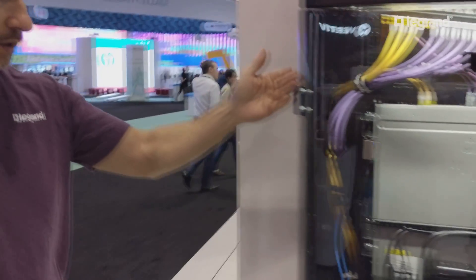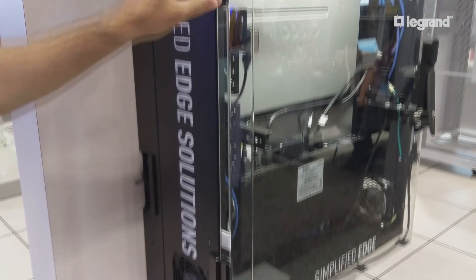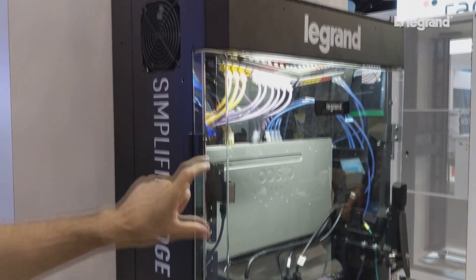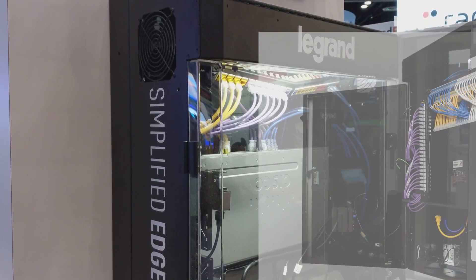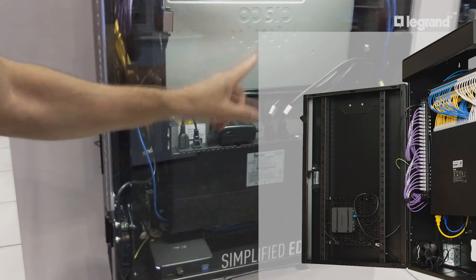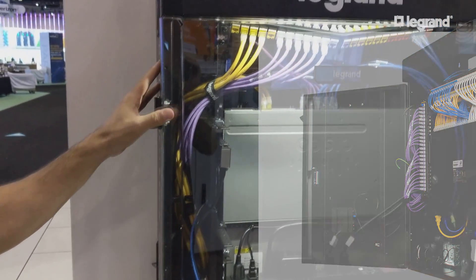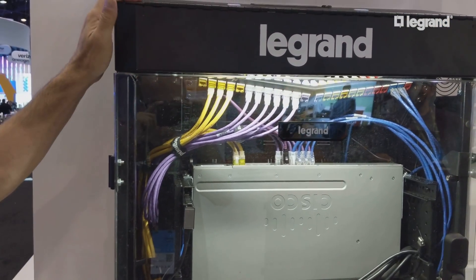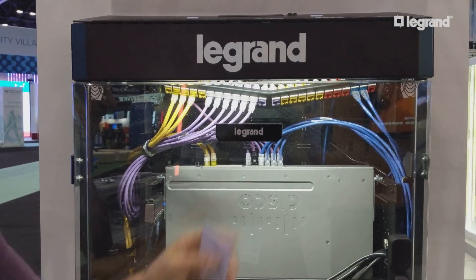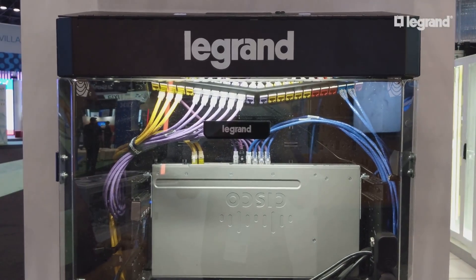Within this chassis are temperature sensors and humidity sensors — which you can't actually see — but they report back to the Raritan PDU as well. Coming across to this side, the front door is hinged on this side for access. The door is available with an accessory we call a lever lock accessory, which allows you to mount non-rack-mountable equipment into the box. That attaches with two brackets in the front and can hold up to 30 pounds. The chassis itself is UL certified — 2416 — for 150 pounds at the rail, which means it was tested with 600 pounds at the rail.